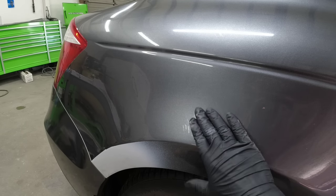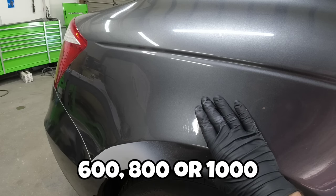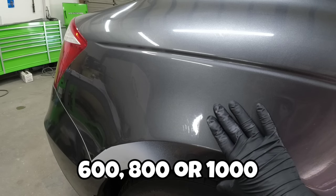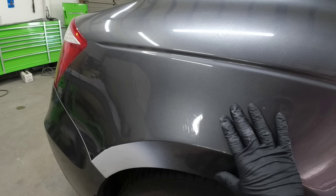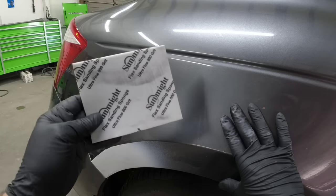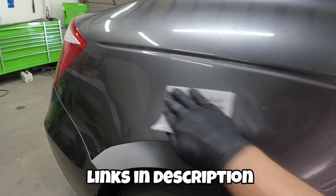In order to do that, we need to knock off the shine of this surface. You can do that with several different types of sandpaper. I would recommend 600 to 1,000 grit sandpaper to sand this nice and evenly, get it smoothed out, and sand out any imperfections. We have a little bit of touch-up paint here that somebody applied at one time — we're going to sand that smooth. What I'm going to use is an 800 grit ultra fine foam pad, which makes it really easy to sand and get around these contours.